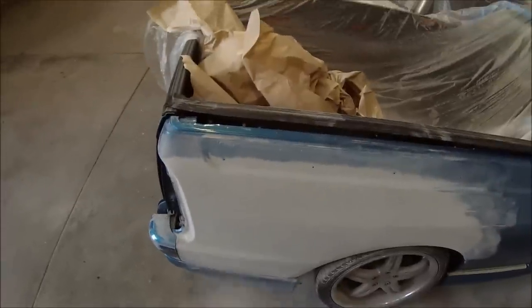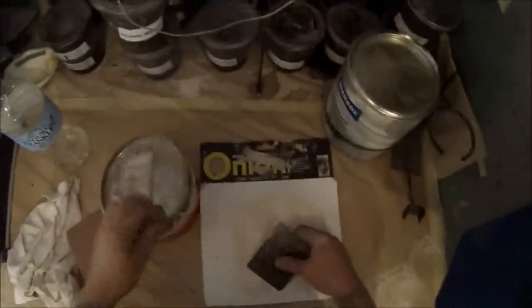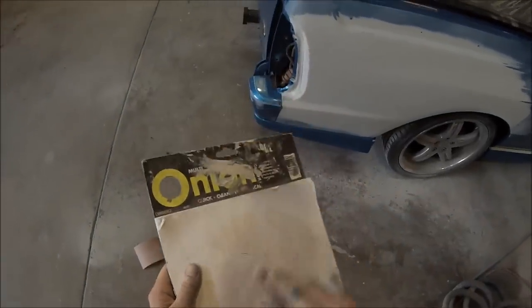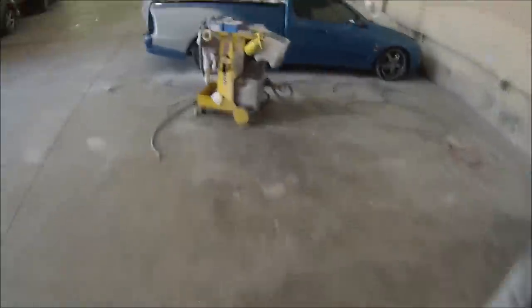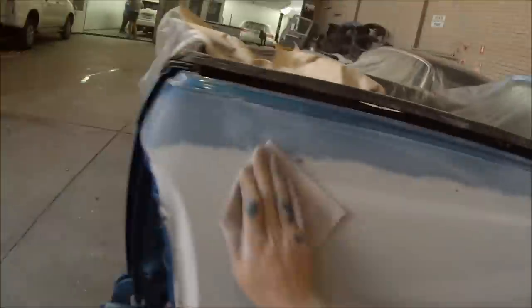On that little back corner I found a small scratch and chip — I decided it was a little too deep to feather out. Sometimes you can end up opening up a bigger problem, so sometimes you're better off mixing up some fine filler. I'm using the Worth polyester ultra fine filler — I think it's one of the best on the market. A lot of people like the U-Pol brand but I'm not the biggest fan; I find that once you paint over them you can sometimes get little spots that may fry up or lift. Put the filler in nice and tight so it's easier to rub out — too much and you'll end up rubbing through in too many areas.